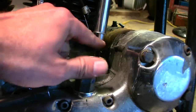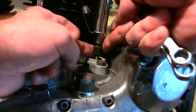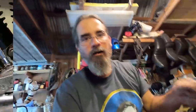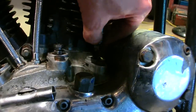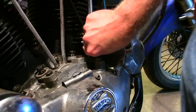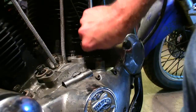I just felt it stop — that means the push rod is butted up against the rocker arm. Now I want to take this jam nut and run it all the way down finger tight. What you don't want to do is run this up so hard against the rocker arm that you can't spin the push rod freely. After you tighten that jam nut down, you don't want to feel any up-and-down slack. What you really want is to be able to freely spin it, and you want to do this while the engine is cold, not while it's hot. I don't feel any slack up and down — you just want to be able to spin the push rod with no slack up and down. I can't stress that enough.